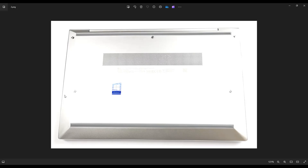So take a small, flat plastic pry tool and then go across this seam all the way around the bottom case, all the way here, inside here, and slowly, gently pry off that bottom case from the rest of the computer. As far as bottom cases go, this one wasn't very bad — this was an easy bottom case to pry off from other laptops that I've worked on.